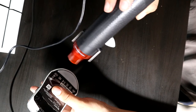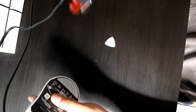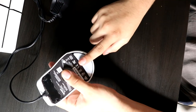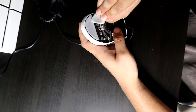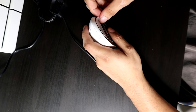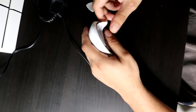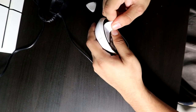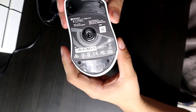We're gonna go ahead and do that same thing with the bottom skate. Again, apply enough heat so that the glue from the skate can come off quite easily. Go around the edge with something flat. You can use a flathead screwdriver too, but just be careful, you don't want to damage the actual skates. Now when you want to pull the skates, don't pull it all the way up, kind of pull it towards you at an angle, because again, you don't want to bend the actual skates.